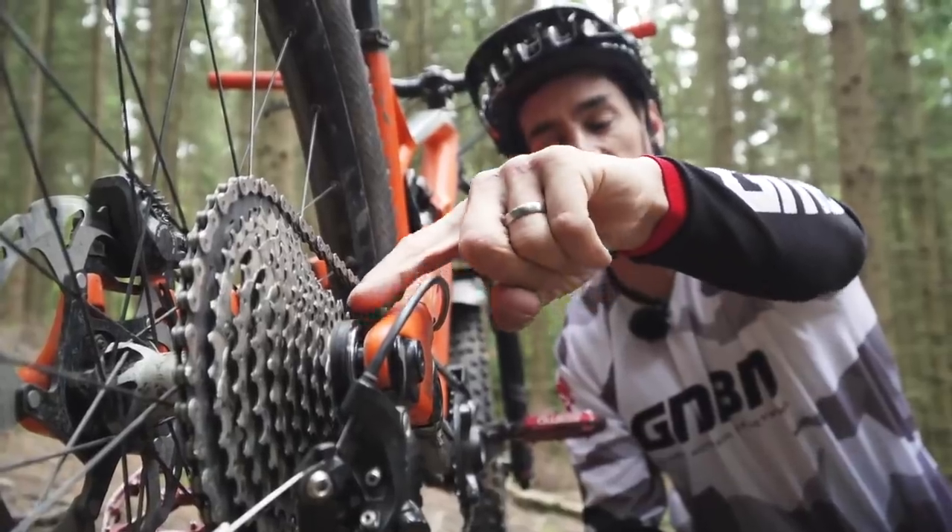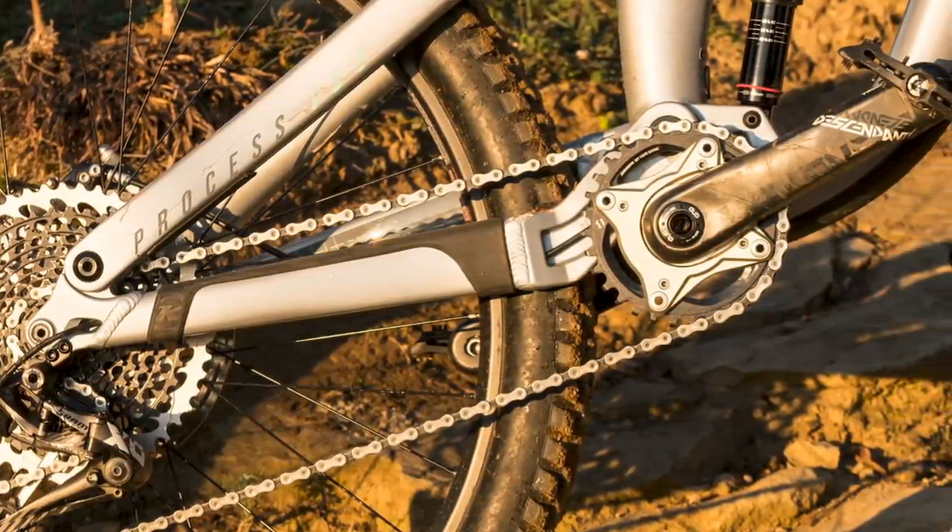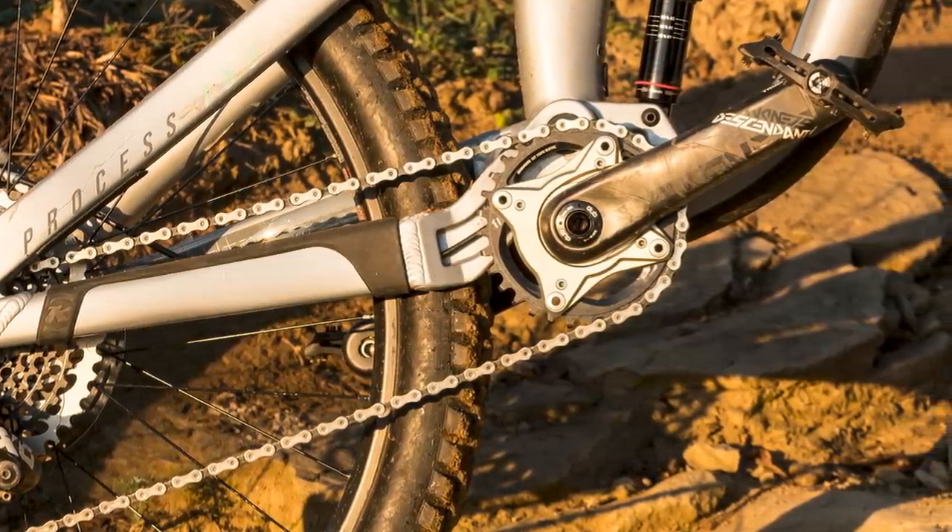People started looking at decoupling devices. Canyon, I think, did it first with a thumb shifter-based system where you could literally disconnect the cassette action. Neil and I also did the basic version where you take off one of your sprockets, put a spacer in, and change the chain onto it so there's a neutral gear. The Ochain looks like it's almost a ratchet with elastomer rubbers that allow for six, nine, and 12 degrees of rearward rotation. A lot of free hubs are moving toward more instantaneous engagement — I sometimes wonder whether that's actually what we want, or just a neat number to put on the hub.